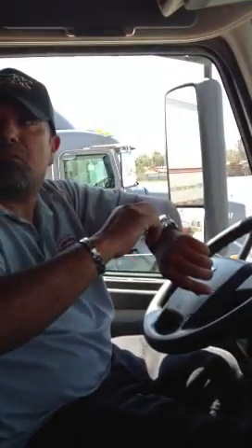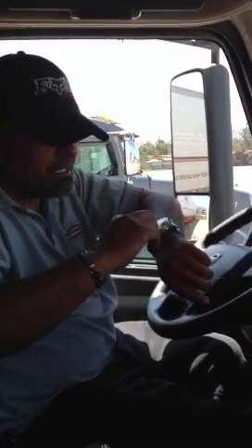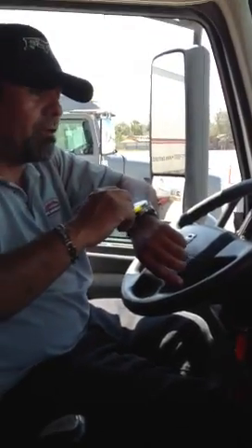Can you please time me? If you don't have a watch, you ask the examiner, 'Can you please time me?' Then they'll start timing you for 60 seconds. Once the 60 seconds is up, you give the reading again. My primary is still at 80, my secondary is still at 80. This was a good test because I did not lose more than 4 PSI within 60 seconds.